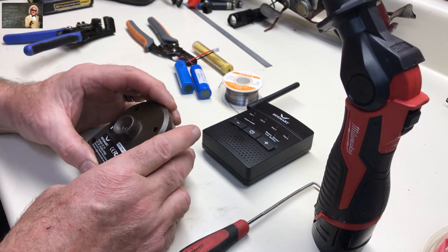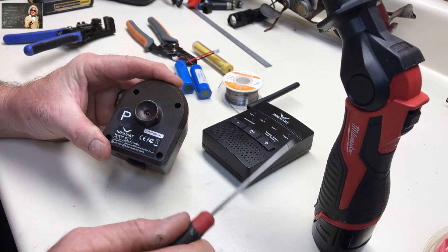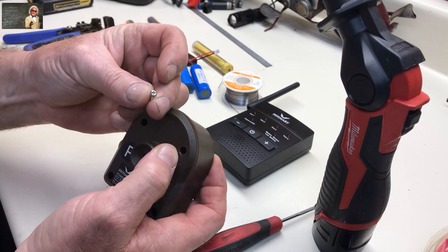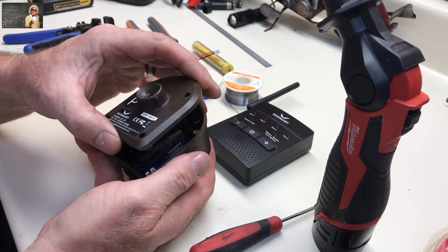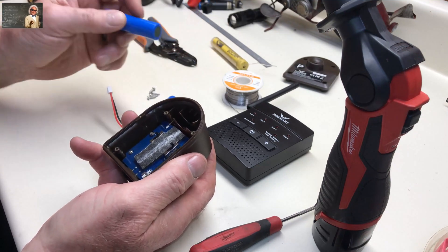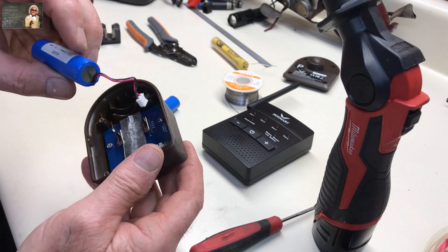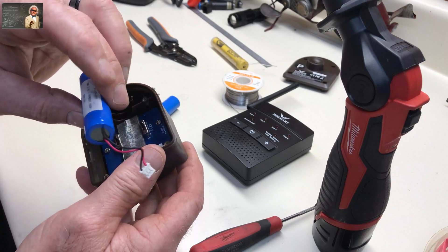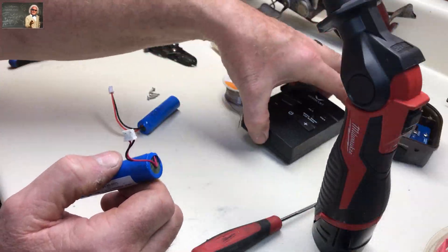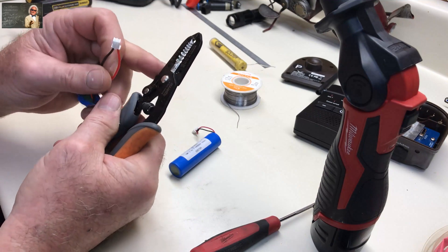On the back of this there are rubber grommets. You dig them out with your pick, which I've already done. And inside there are these tiny little Phillips screws — you take those out and the cover comes right off. Their battery was stuck to sticky tape. They set it up so that you have to buy a new one instead of getting a new battery; they don't want you to get a new battery. We're not going to do that. This goes for just about everything that has a lithium battery in it. We are going to cut the two-pronger off there.